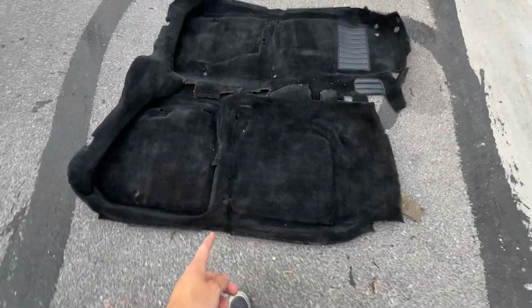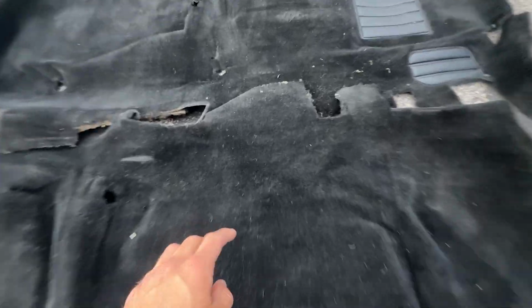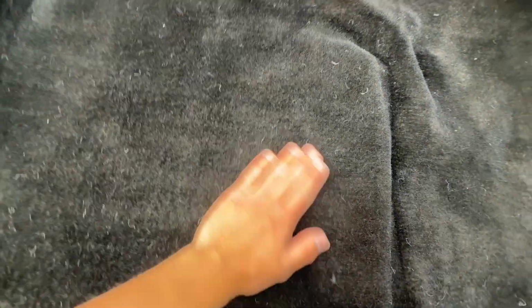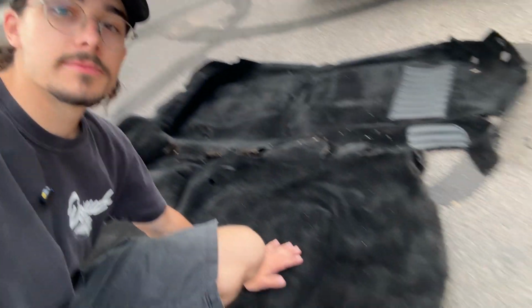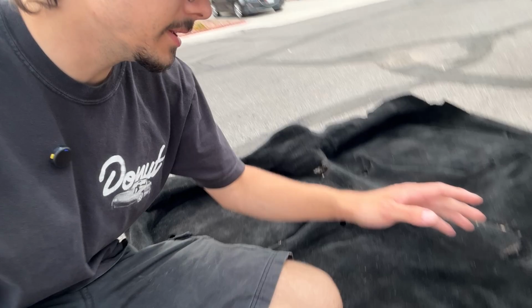All right, the carpet is done. Last thing I want to do is just take the air compressor and blow off a lot of this stuff that gets loosened up from all the brushing, but overall it looks actually way better than I thought. This is definitely the best method for changing the color of any carpet. The only trick is to do really light coats. Just go over it a lot of times. It took me 2 cans to do the whole thing.